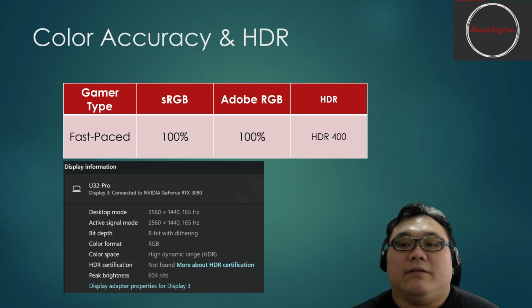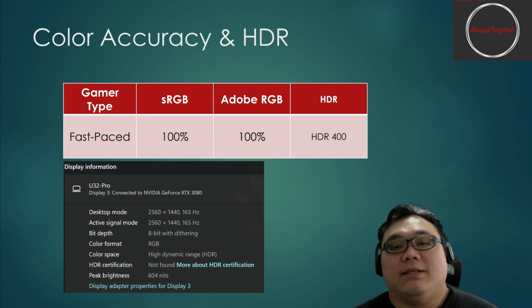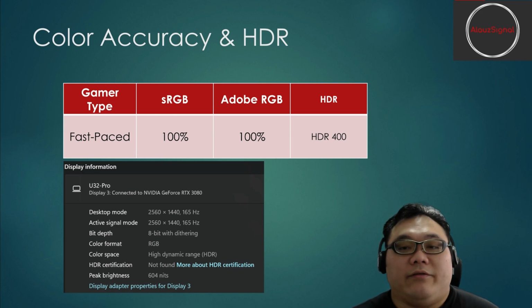The monitor is rated for 100% sRGB and 100% Adobe RGB coverage. Out of the box, at the factory settings, I personally noticed a visible yellow tint to the screen, most likely due to the Adobe RGB coverage, as it covers more of the red and yellow spectrum. Then after manually calibrating it to my own preferences, it still retained a slight yellow tint, especially with HDR enabled.